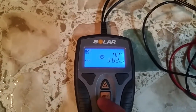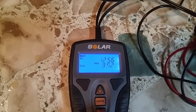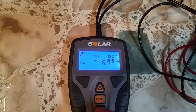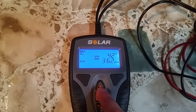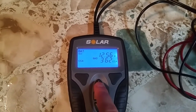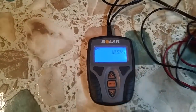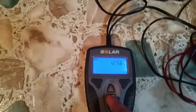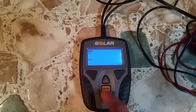It's only going to be putting out 362 cold cranking amps. So this battery is shitty — it's not good at all. I'm just curious to see if I throw 1000 in there. You can hit enter and it'll go back, then you can go back to sealed lead acid, cold cranking amps, and I'm going to pump it up to 1000 because it says it's got a thousand.